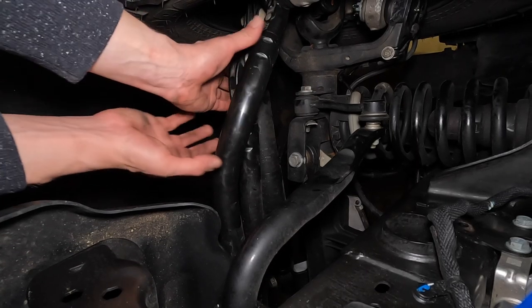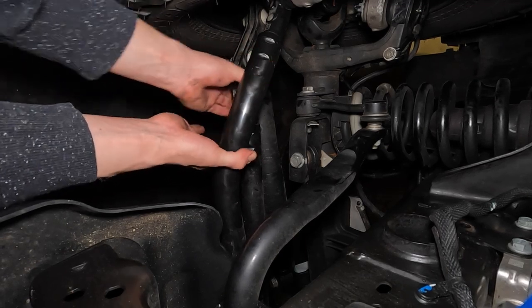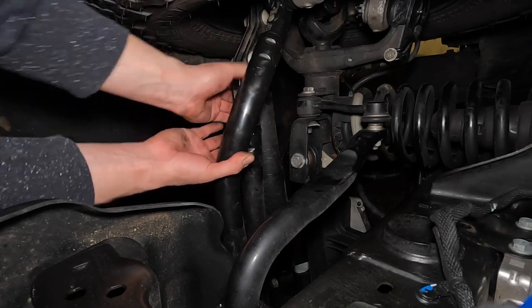Looking under the Jeep, I feel like this might be the noise. So what I just showed you guys is the tie rod, and what I think is happening is the tie rods have like a ball joint on the end of them as well — they sit on a ball and they can rotate on the ball. I believe that's exactly what we're experiencing — I think it's rotating every time we do a turn. So I will be taking the tire off and taking a wrench to it to see if I can tighten that a little bit more. I've already tried tightening all that stuff prior, but maybe it came loose from all the times we went off-roading. That is the last thing I will check. If I cannot get it to go away after tightening that, then I'm gonna have to go with it's a normal noise and it's something I just got to live with. Tomorrow is Saturday — I'm taking big bird out, so I will be doing that job on Sunday.